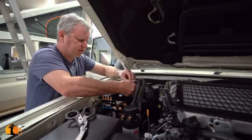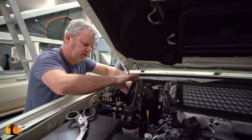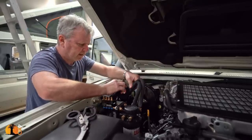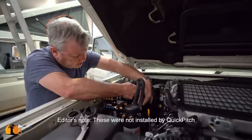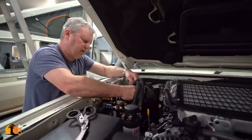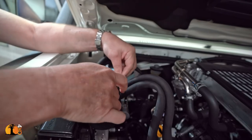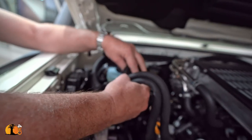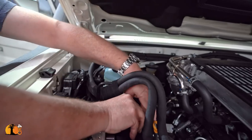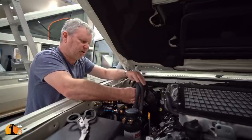These extra fuel lines, put in as part of the extra fuel filter system in this vehicle, were not properly tied down. They were rubbing on the brake master cylinder there, and I have to now do something about it. Protect the components on which they might rub, and of course the rubber pipes are the most vulnerable things, and if you get a hole through that rubber pipe, the vehicle will stop. So don't assume anything.